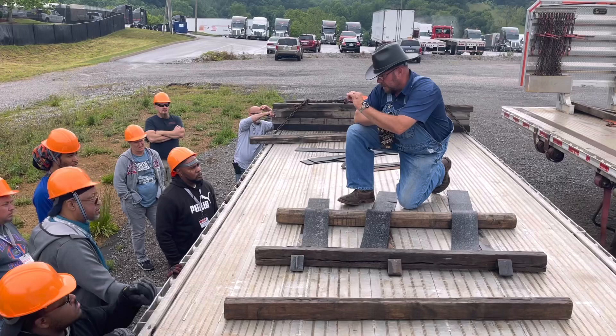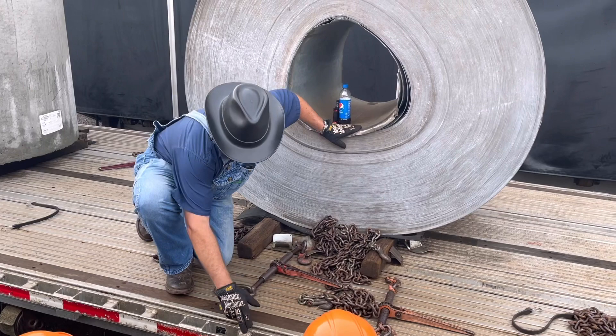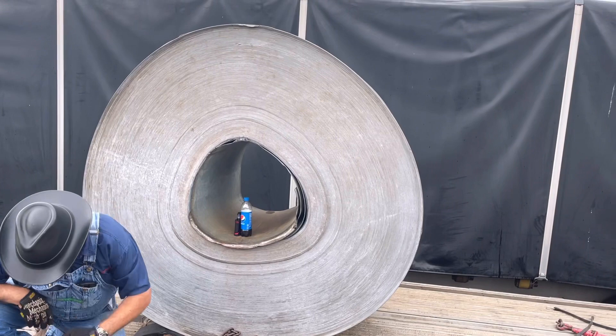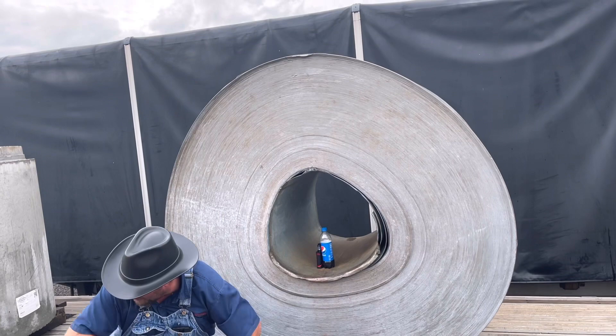As long as you have a gap in there — 20,000 pounds or less — always try to set it up where the center of your coil is in between two coil racks. If it's a small coil, I could teardrop my chain right there at 6 o'clock. My forward chain could drop down right here and come back to hook. My rearward chain on this coil could drop down here and back to hook. I just planned all that out right there.